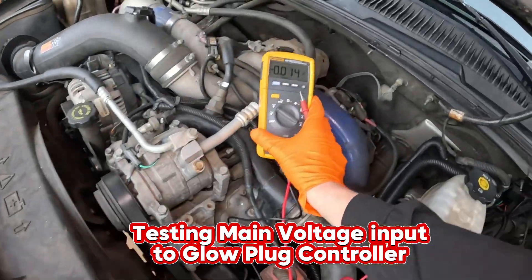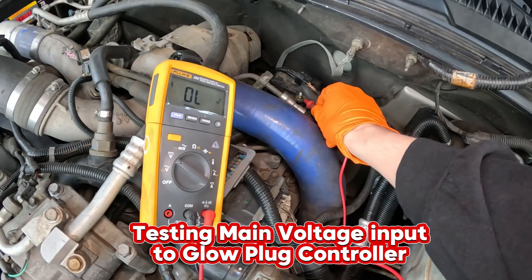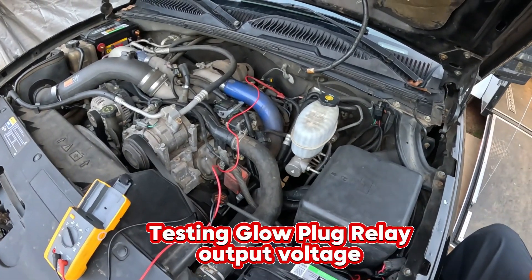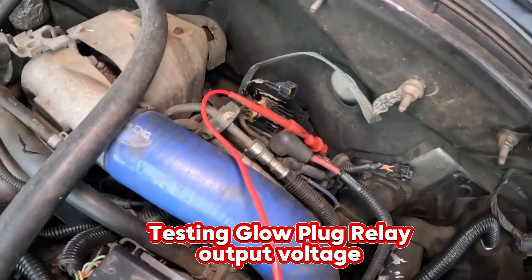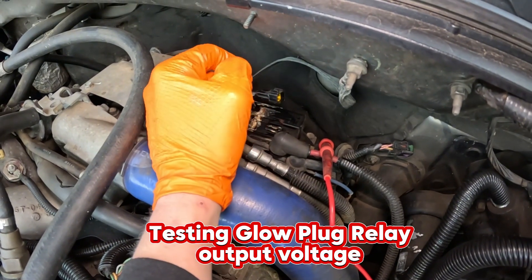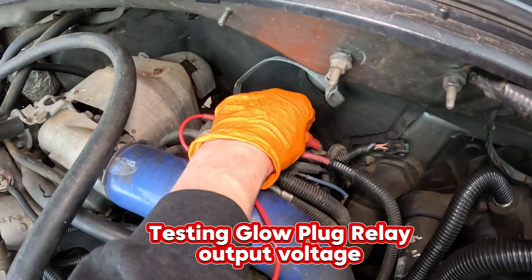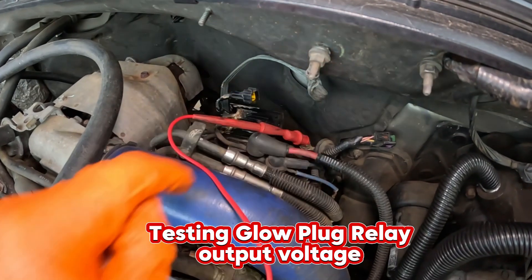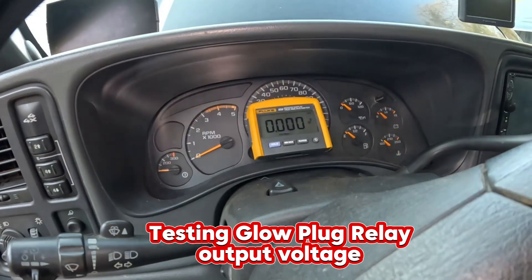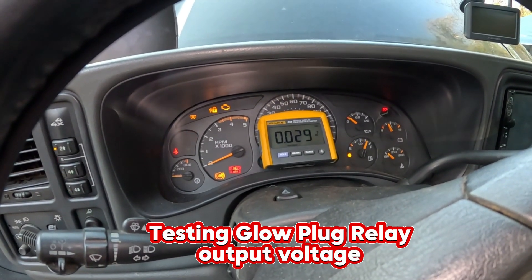This is the hot wire coming straight out of the battery, and we've got 12.6 volts as we should. I have removed the cover — we have two relays here, which is great because those are easy to get and replace. I want to do some more troubleshooting. Putting our multimeter, still on DC volts, on this plug here to see if we're getting voltage. We have no voltage.